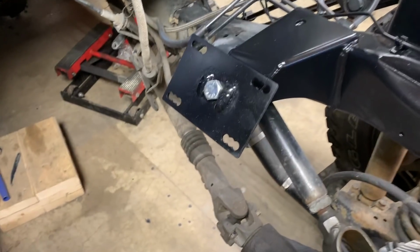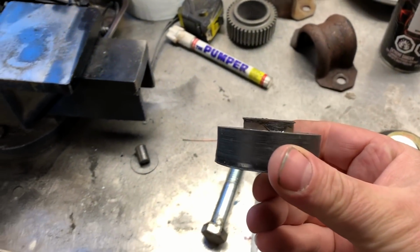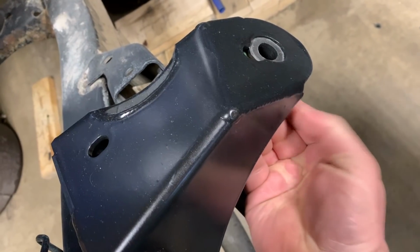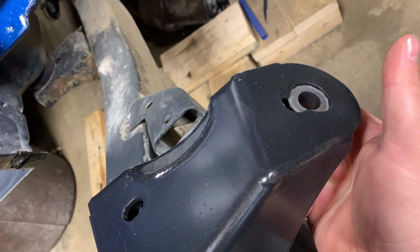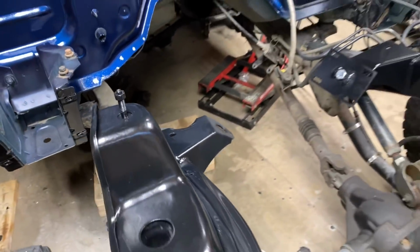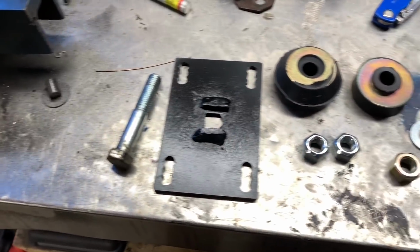So of course you guys saw I welded the mounts. And what's really important is the way the mount sits in there. I'm going to grab this bottom one because you see it's kind of beveled there. So what it does is that it sits right up in there, and that's how it fits. Otherwise, it could be possible that the mount could slide up in there. However, welding the keystock, putting the bolt through, it works perfect.